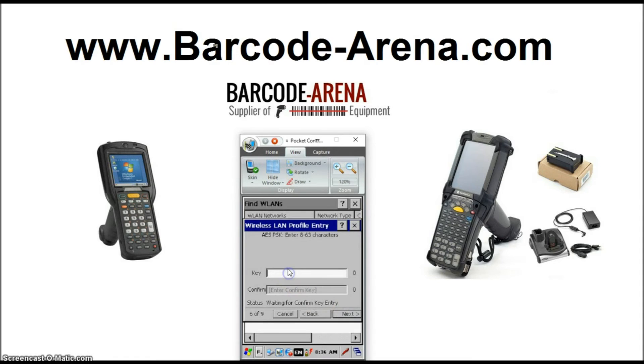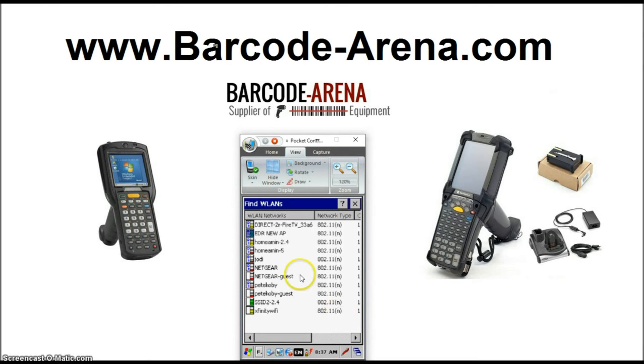We're going to hit Next. I'll get our password. Click Next. We're going to obtain our IP address automatically. If you're doing more advanced networking, you can uncheck these and manually input your IP and DNS. Click Next. We always recommend CAM, which is the highest performance setting. Click Next. We're optimizing for data. Save.